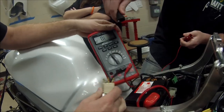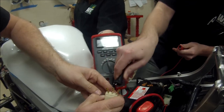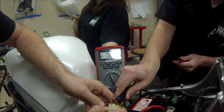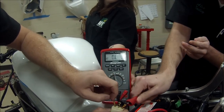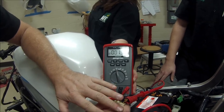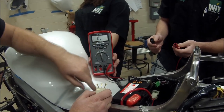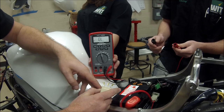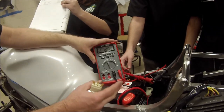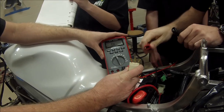Hold this, please. It is best to use alligator clips and leave it alone, okay? Zeroed our leads to take out any potential resistance in the leads themselves. So now we're going to go ahead and hook across the stator. It's fine without the fuse in it, okay? Let's go ahead and test that.